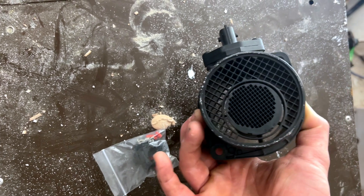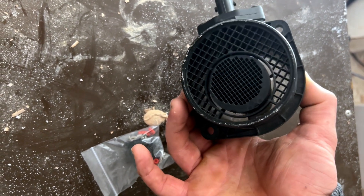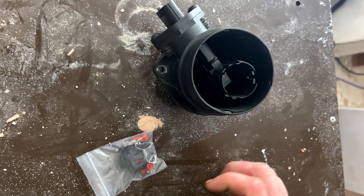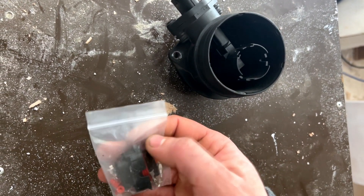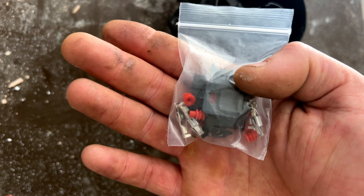Most of it came from AliExpress - it's almost sponsored by AliExpress! We've got a MAF sensor to control airflow - it's from an MG6 1.8 TSE, which is sort of the same engine as a Rover 75 1.8 Turbo, just a bit more refined. It's made by Saic. Got it from a breakers on eBay for about 15 pounds. Unfortunately it didn't come with a connector, so I had to get one from AliExpress - a five-pin one for about £3.59. I've checked it fits but I don't want to open it now as it's got all the tags and crimps in.